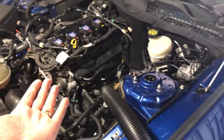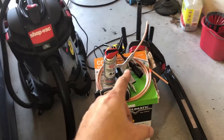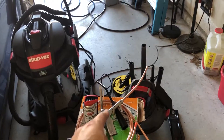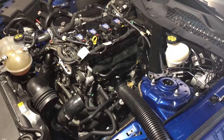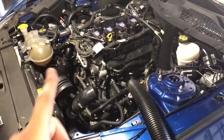In a nutshell, this is pretty much what I did. I used the CRC solution to get the gummy deposits out, then used the cable tie wand in the drill to get the big chunks out, and then went through with the walnut shell blaster to finish the job. Now you can see the difference. It's time to put this car back together and see if there's any difference in performance. Thank you very much for watching — take care and as always, have fun.